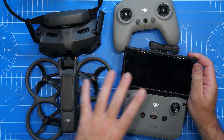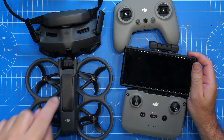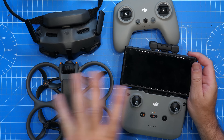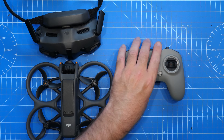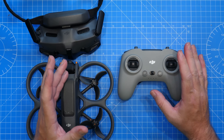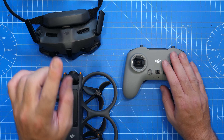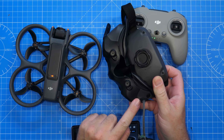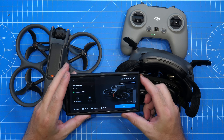As I mentioned earlier, whilst this is for most of DJI's standard consumer drones, there is actually a slightly different process to do this check on the DJI Avata 2. The reason for this is the Avata 2 is not compatible with the more traditional DJI remotes. Instead, the Avata 2 uses either the DJI FPV remote or the DJI RC Motion. Neither of them are able to connect to a smart device, and instead you would connect your smartphone to the goggles via a USB-C cable. To do this, I have a USB cable connected into the USB-C port on the bottom of the DJI Goggles 3, and then I've got that connected into my smartphone.